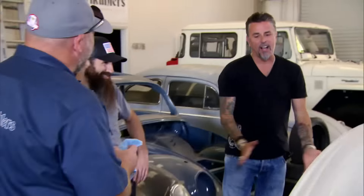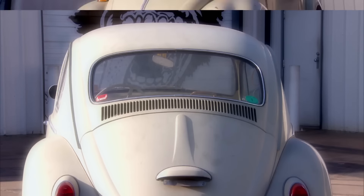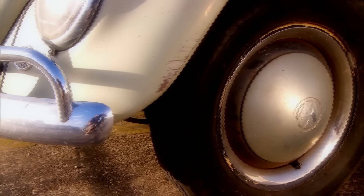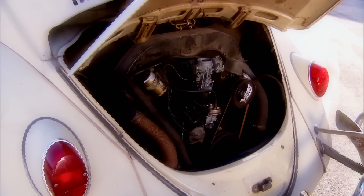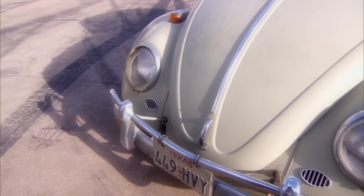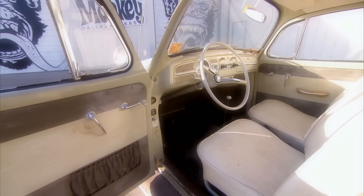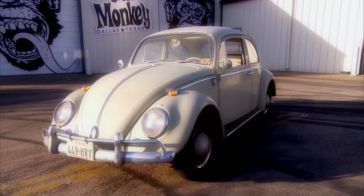I have no idea what these are worth. All right, man, we'll do it. Treat us right on the little van, so let's see what we can do with this. I really like this little 65, and I want to do it upright, so here's the plan. We're gonna stick it to the ground with a suspension package from Air-Cooled Custom VW, then replace the stock wheels and tires with two-piece 17s front and back. With only 40 horsepower from the VW engine, it just won't make it for us, so we'll turn to Elliott again for a motor making about five times that. And Coy gets a break because I'll bring in a guy to fix the whiskey dents and buff out the original paint. I'm setting the deadline at just two weeks because Aaron booked himself a little time off, so for once I can bank on him getting this build done in time.